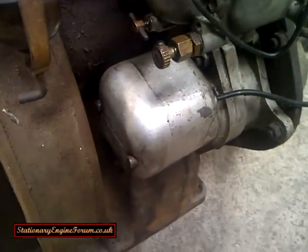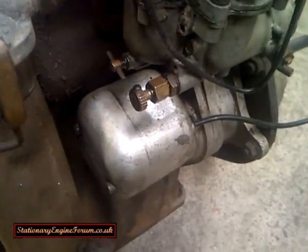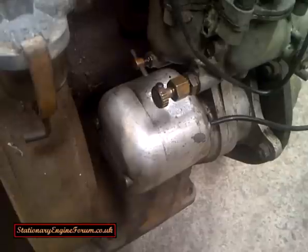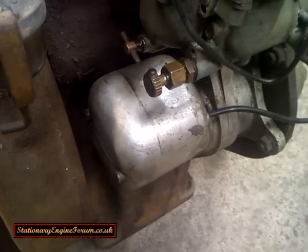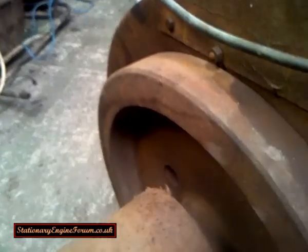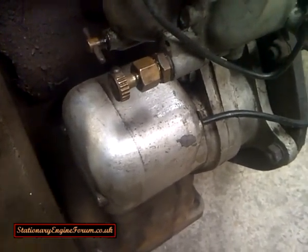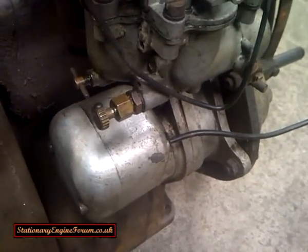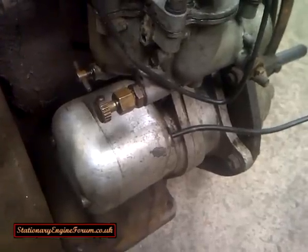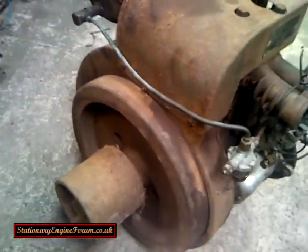The way to adjust the magneto is to take the whole assembly off — do not rotate the magneto — then rotate the engine a little bit and put it back. It's a kind of trial and error. What I do: set the engine to top dead centre on the flywheel, take the magneto off, spin the magneto in my hand until it just clicks, and then the moment it's clicked don't rotate it anymore — carefully put it back on the engine and you should have your timing set to top dead centre.